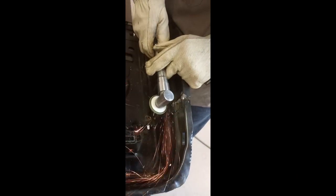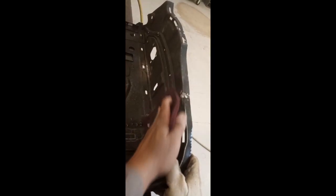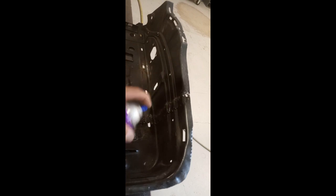Now that we've finished that, we're going to dress down those welds. On the back side we want to leave as much weld as possible — it doesn't have to be flush or nicely finished. Then we prepped it, shot a little bit of epoxy primer on there, and we're moving to the outside.